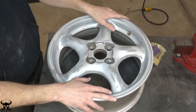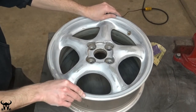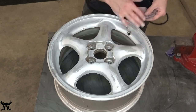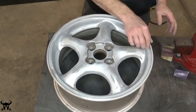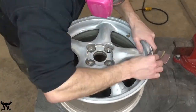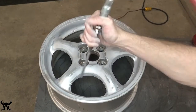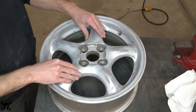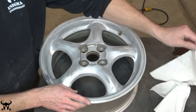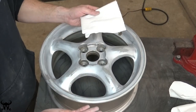Now I've got the gloves off and I'm going to run over it again with the 100 grit. I'll knock down any really bad spots with the 100 and then go back over that with the 320. Really I'm just trying to find any little bumps and take that 320 to smooth them out. This thing is feeling smooth. The next thing to do is to spray it down with some isopropyl alcohol. I use shop rags — I have better success and feel like there are fewer cloth particles stuck to the surface when I'm done.